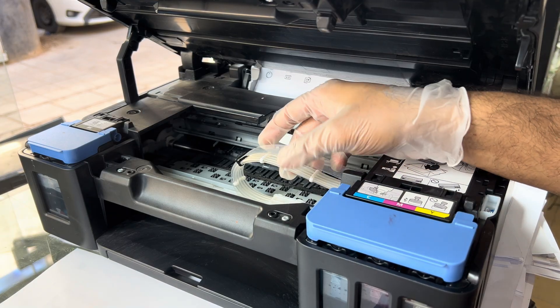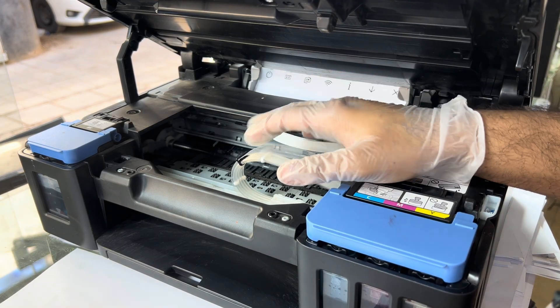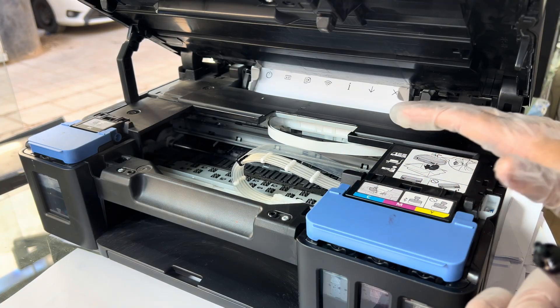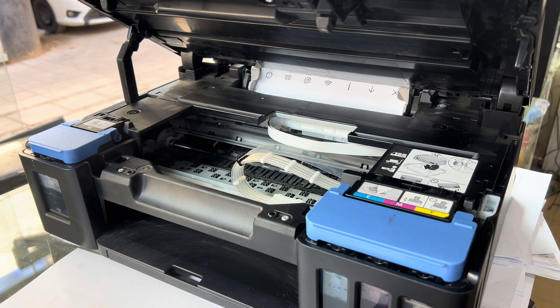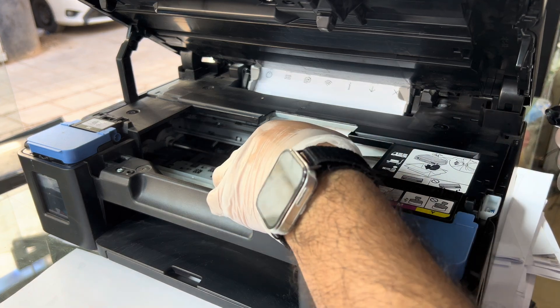The issue is the ink is dry in the print head, and you can see there is no ink in the pipes — totally there is air and the heads are dry. So today I'm going to do an ink flush using the computer, or you can use the panel buttons to flush the ink.